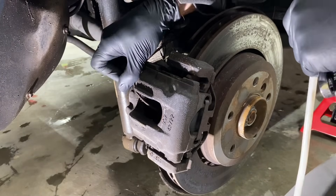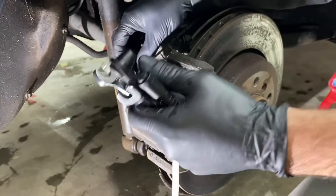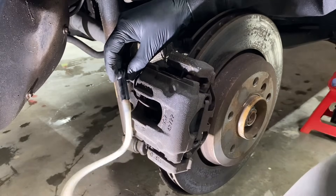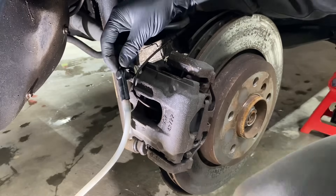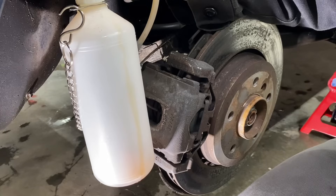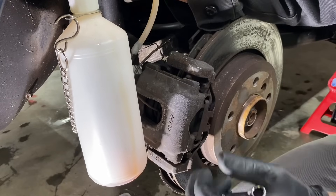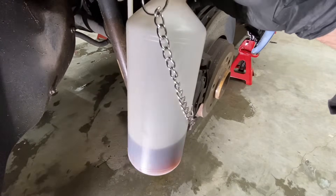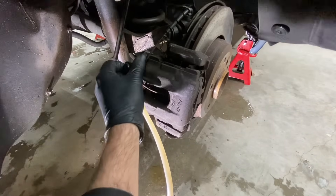Now the easy part — just locate the brake bleeder nipple, which usually has a brake sensor attached on two of the four wheels. We're going to start at the farthest bleeder from the master cylinder, which in this case is the passenger rear — for European vehicles, that's probably going to be the rear left. Take the right size wrench, get on the bleeder nipple, break it loose — it only takes about a quarter turn. You can see we're starting to get some nice dirty fluid in there. I'm going to try to fill up the bottle evenly across all four brakes, so about a quarter of the bottle each caliper. Now take a nine millimeter wrench and snug the bleeder screw back down.